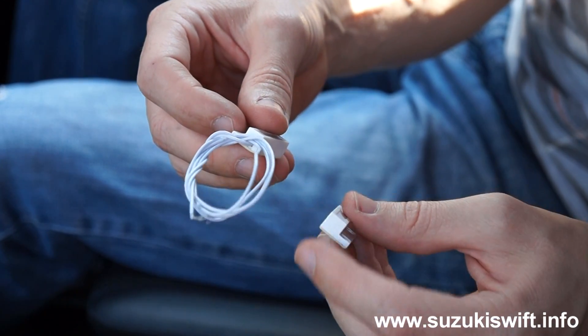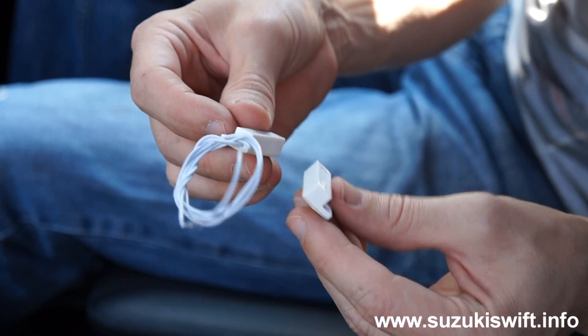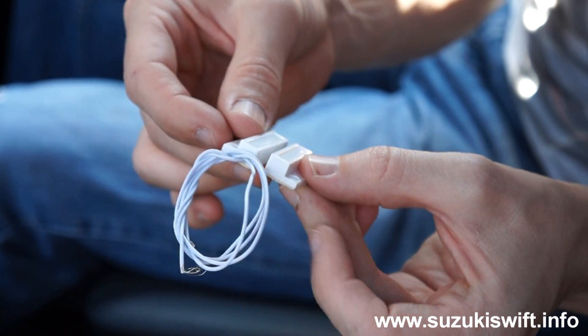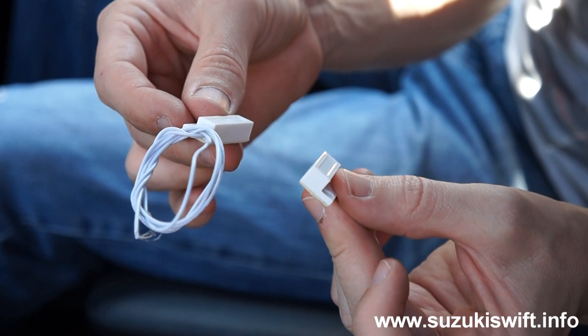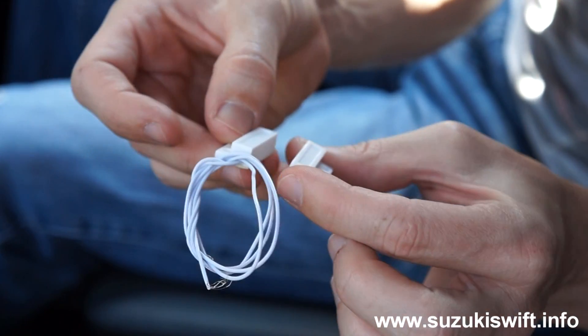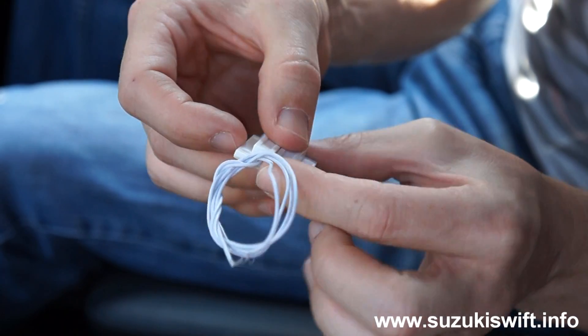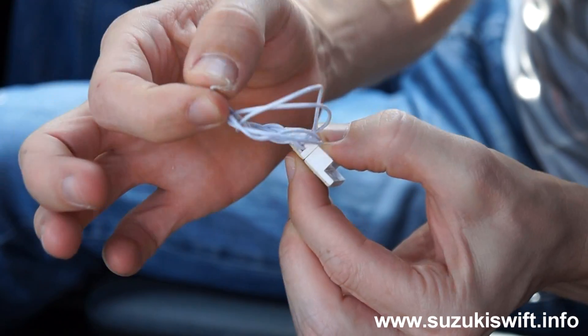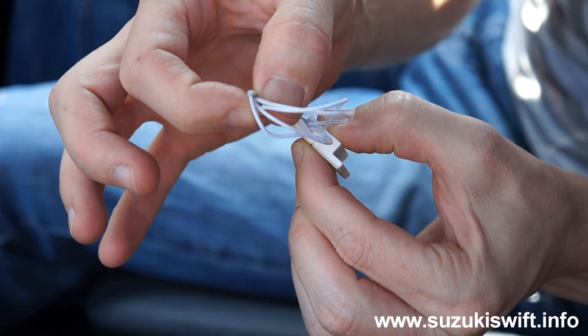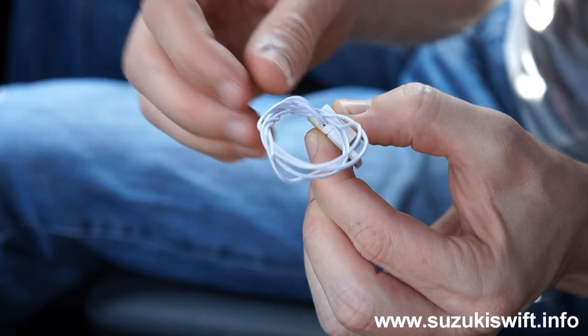To make the remote safety system not start when the car's in gear, I'm going to position these sensors around the base of the gear shifter. These are magnetic sensors that you can buy for less than a dollar off eBay. When the magnet gets close to the sensor the circuit will close, so I can connect one end to the car's body and the other end of the two wires to the neutral safety switch built into the Viper remote start system.